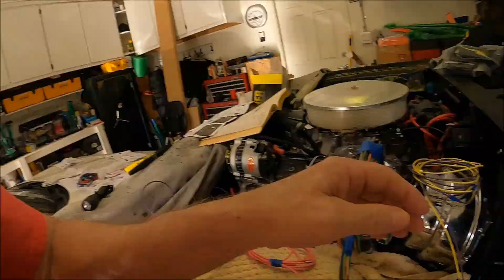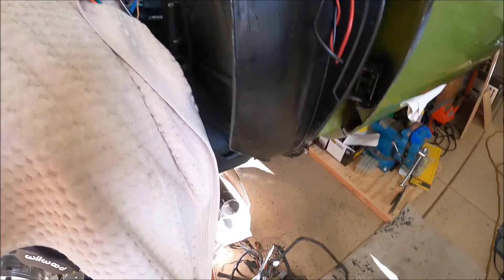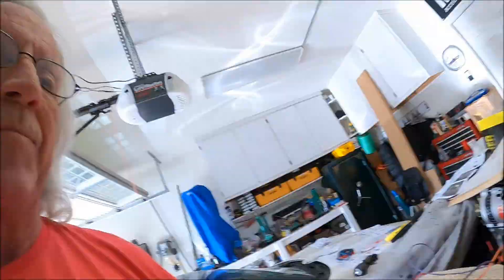One other thing related to the entire wiring project: I'm trying to split up the circuits separately. The way the factory did it was to run all the wiring together and basically just wrap it all up in electrical tape. I'm going to, as much as possible, separate each circuit so that if there's any trouble or I have to rewire something, I don't have to undo the whole harness — I can just work on that section only.